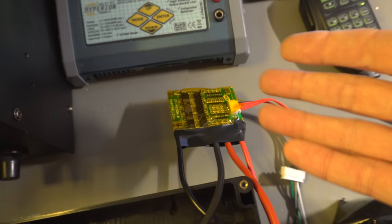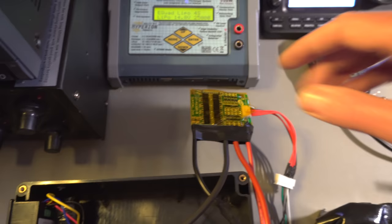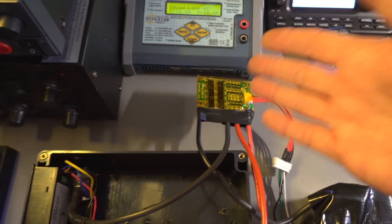In the Twizy it's a very small space, not well insulated, but because it's so small you can get localized heat just to warm you up a bit. I'm going to start charging this up. It would be great if it all works because it means it'll turn off at the proper voltage — if one cell goes lower than the others the BMS will cut off. You must have a BMS; it's just too difficult to manage without one for longevity. A lot of people slag BMSs off and I get why — you never know what they're doing — which is why we've started doing Bluetooth BMSs. Eventually even these small BMSs will have a way of connecting, like a little Bluetooth chip, and that makes the world of difference.